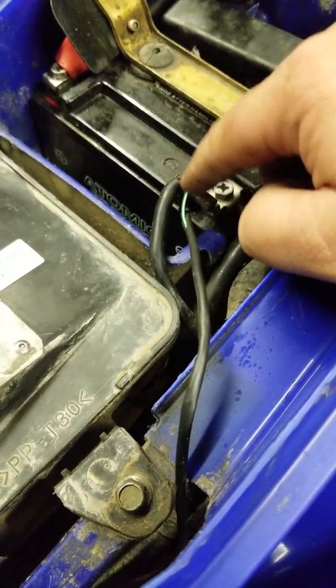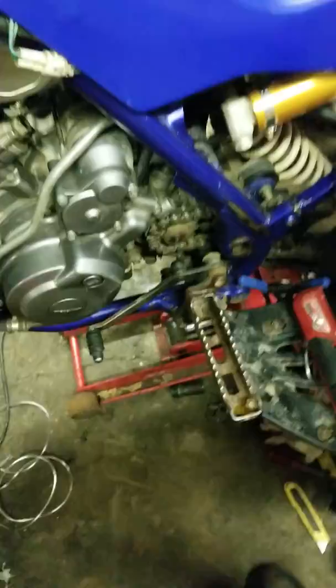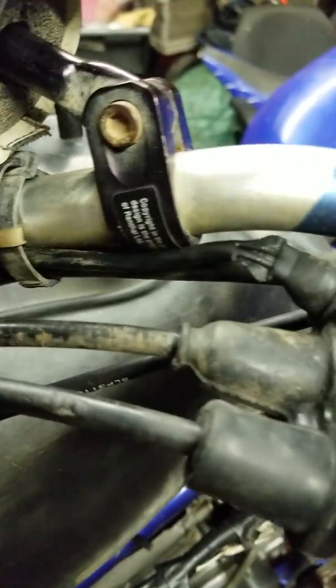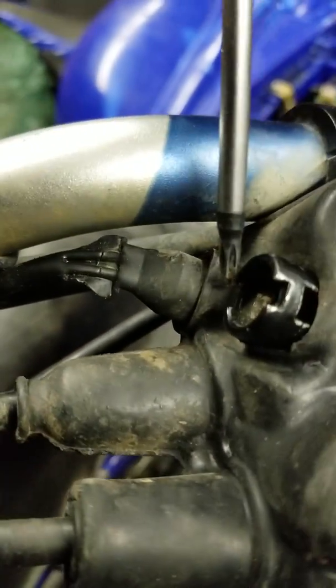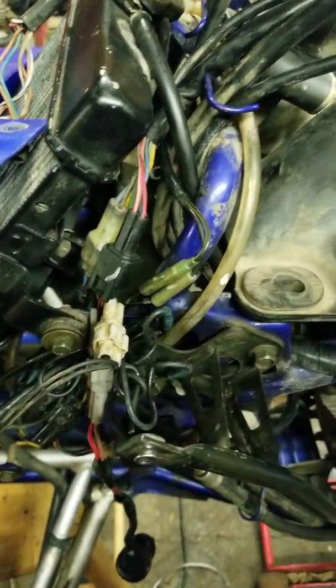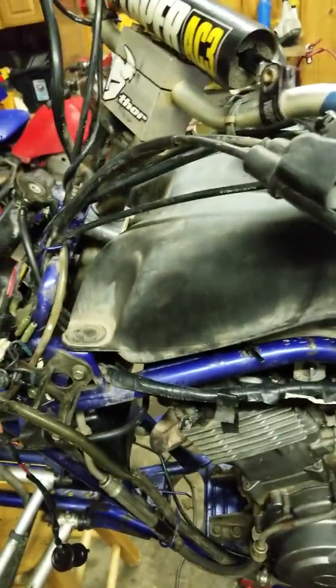I did a bypass here because I found an issue with the one for the reverse. And then there's another thing going on up here with the parking brake — this assembly is missing. I think there's something here that should be here for the parking brake; maybe you guys can tell me. I think this is a housing for another micro-switch. If it is, I'm looking for the wiring that goes to that, because if we are having an issue with the rev limiter circuit, then I suspect that.